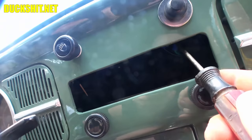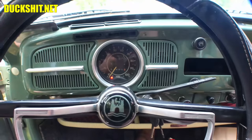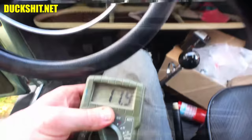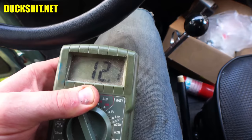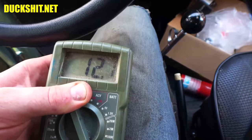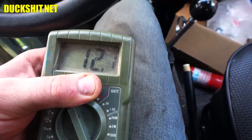Which means if I kill the engine, the generator light should come back on. There it is. Now we just need to check voltages and make sure it's charging correctly. Let's check our voltage — 12 volts. Still 12 volts. I suspect we have a bad regulator. I just put this thing in and clearly it's not working right. I'll put the old one back in there and just see what we've got. If you remember, the reason why we replaced the old regulator wasn't because it wasn't regulating properly — it actually was. The problem was it was killing the battery, sucking it down. So if I put the old one back in circuit, it should be fine.